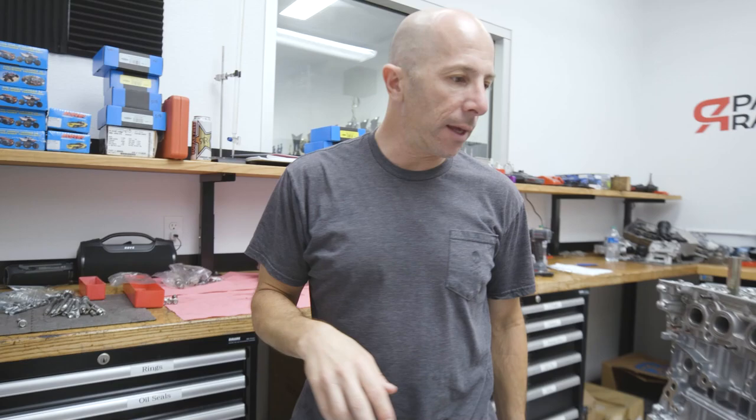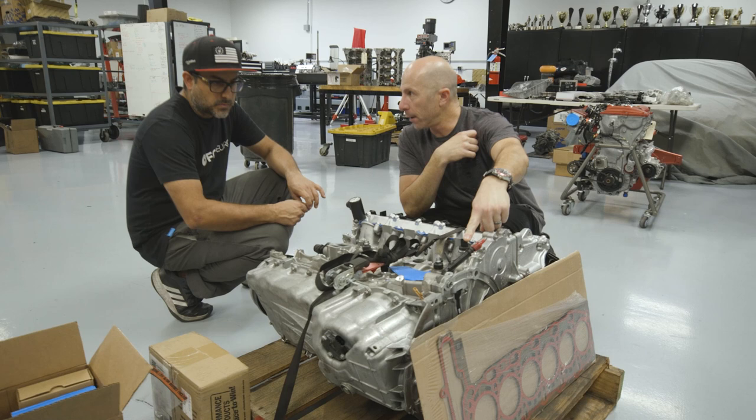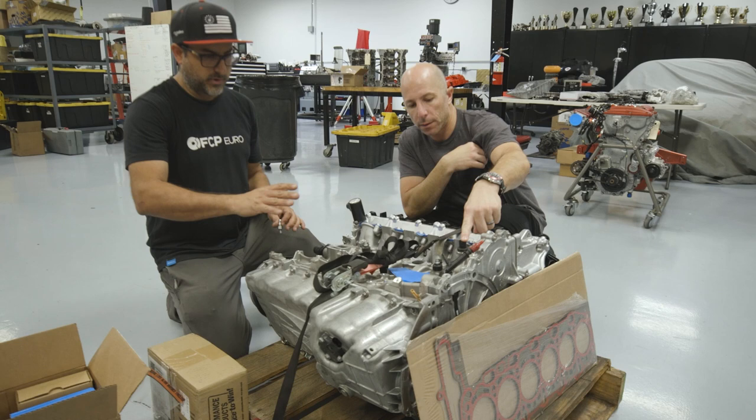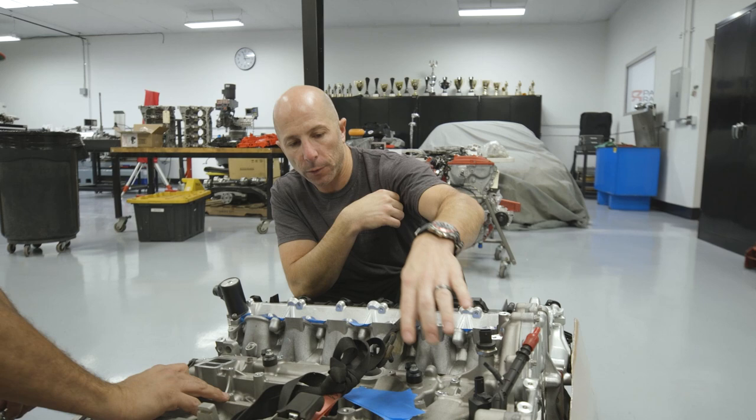So here's the exhaust cam. It's just a regrind. Calfer did it. And the Calfer file is for the stock oil pressure sending unit. Okay, so cool, use that. That's what G was saying: if we use all the stock sensors, because that's what you guys are running, you'll need some sort of feedback for the oil pressure. If you don't hook any power to this, it goes to maximum oil pressure, like 150 psi or 120 or something like that.